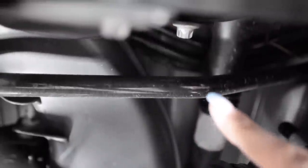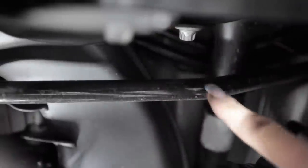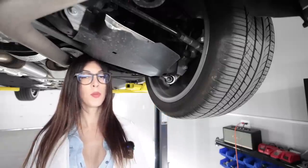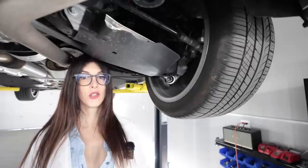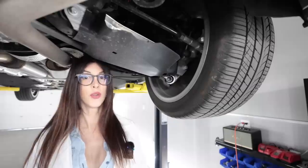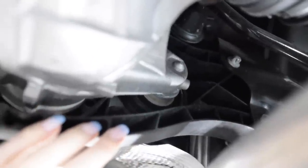When I stuff my DSLR camera up inside here, almost everything is made out of aluminum other than those two upper links, which look like steel. The rear anti-sway bar, though, for a car that weighs almost 5,000 pounds, is pretty dinky — about the size of my index finger. This car is equipped with the rear wheel steering package, giving up to 4.5 degrees of angle in the rear wheels.